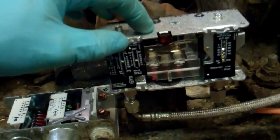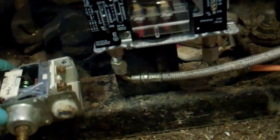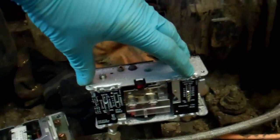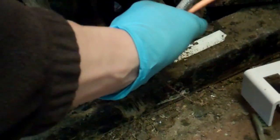Different manufacturers — this one's a Danfoss and that one's a Ranco. So we've turned the bracket round, and that's moved the body this way a bit, otherwise the hoses wouldn't have been long enough. We'll put some cable ties around there and tidy them up once we've checked for leaks.